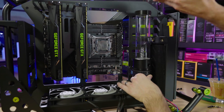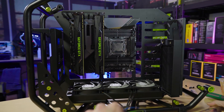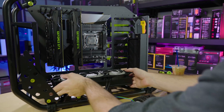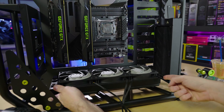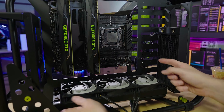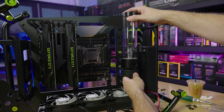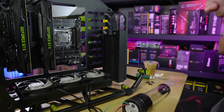For the radiator — they're not all the same sizes, but I'm not going with a smaller one because I'm running two graphics cards and need as much cooling capacity as I can get, which is why I'm running this thickness. If I flip this radiator over and do 90-degree fittings coming out of it, we'll have just enough height to come up and across. One can go from the pump — actually it'll flow the in-port, so it'll probably reverse and flow backwards. That's the stuff you have to think about that makes this kind of tough. It's amazing how fast this chassis fills up with stuff.